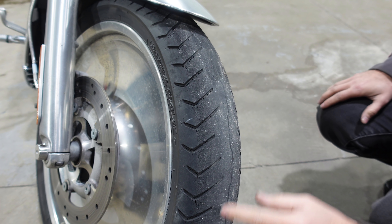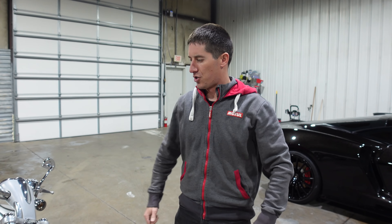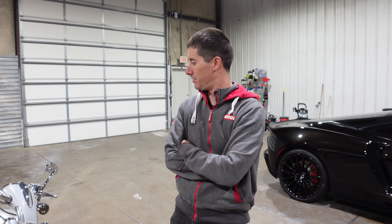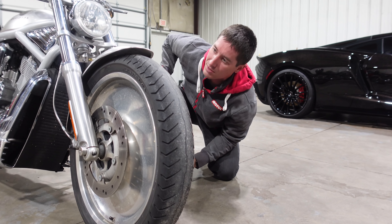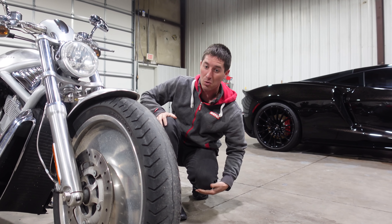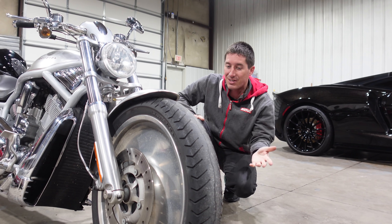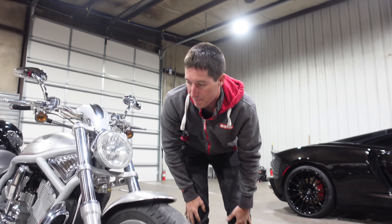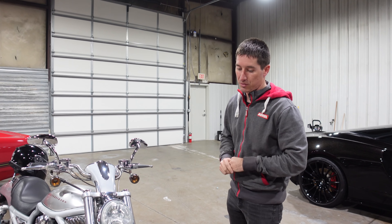I took it out on the highway - it's a super windy day and the front end felt like it was washing back and forth. These are cracked all the way down the center and cracked in every direction. People are still in the comments saying you shouldn't do burnouts on those tires, you're so wasteful. I'm like what is wrong with you - these tires are going to kill somebody. That's why I need to kill these tires before they kill me. Date code is 42/15 - well that's actually not that old. You usually don't see cracking this bad but then again this was just parked outside its entire life. Seven years old now - still a really really old tire.